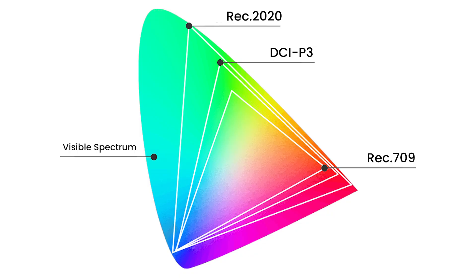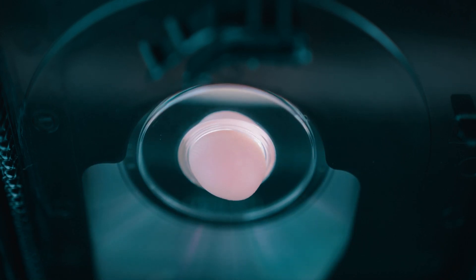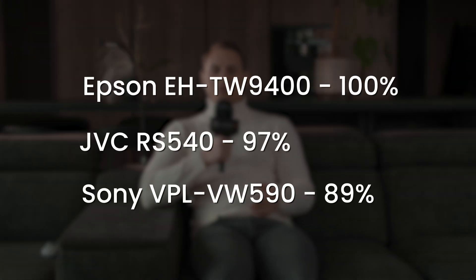For regular Full HD movies, the desired color space is Rec.709, which is the narrowest one in the diagram you can now see on the screen. This can be obtained with almost every technology used in home theater projectors. For movies and games in 4K HDR, they use a very wide BT-2020 color gamut, which allows correct reproduction of the very saturated colors that occur in nature. However, most video content — whether on Ultra HD Blu-ray discs or in streaming applications — is limited to the DCI-P3 color space, because movie studios usually operate in this system. Full or nearly full reproduction of this color gamut is possible in premium lamp-based projectors such as Epson, JVC, or Sony. So you can't say that RGB laser gives nothing on the subject of colors, but it's not a big gain with the content available in homes today. The ability to obtain saturated colors has nothing to do with faithful reproduction of color or the smoothness of tonal transitions — those two much more important things depend on the image sensor and processor, not on the light source.